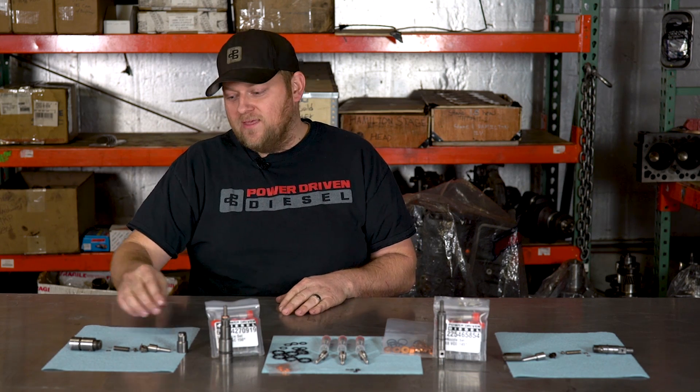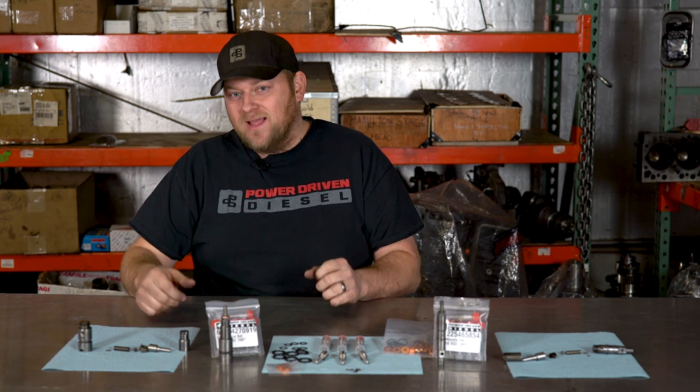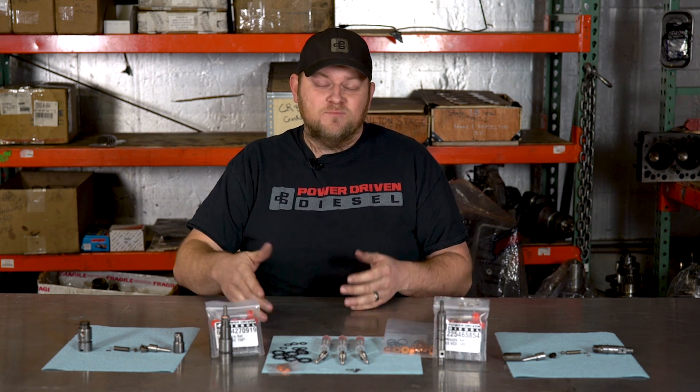Once you put these on, make sure everything's clean, slap it back together. You can torque the nuts to around 30 to 35 foot-pounds — that's fine. Up around 40 you can sometimes crack the nuts and split them; around 20 they'll sometimes leak. Our guys that build these don't even have to torque them anymore — they've built so many. But if you want to be precise, somewhere in the mid-30 foot-pound range is the proper torque spec. Anyways, great way to save money. If you're new here, go ahead, like, subscribe, and check us out next time on Partspin.